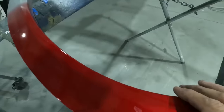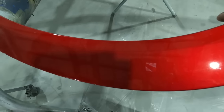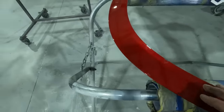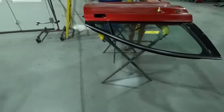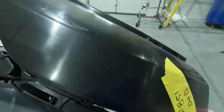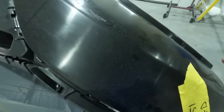So this will hit with a 600 grit because we're gonna be fully painting this, being that we're coming up to the actual fender with this one and blending the door on this. So we'll prep that out. And then we have our new fender to get prepped out as well. This here's the piece I was talking about that is the lower section of the actual bumper. I wanna make sure this is on the estimate and that it has the raw prep as well on it. So we'll do that. We'll grab the fender out of here real quick.